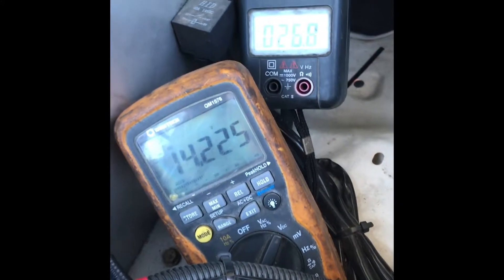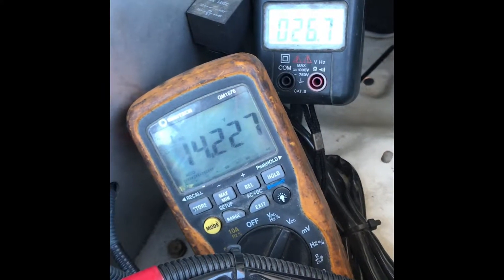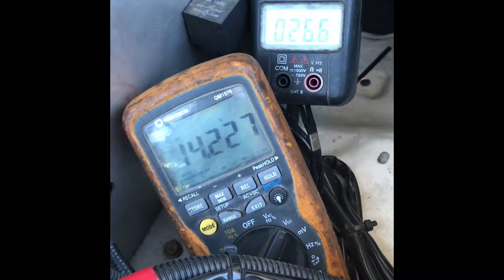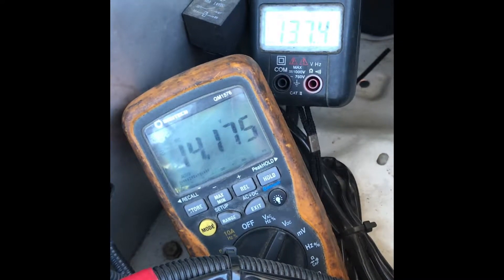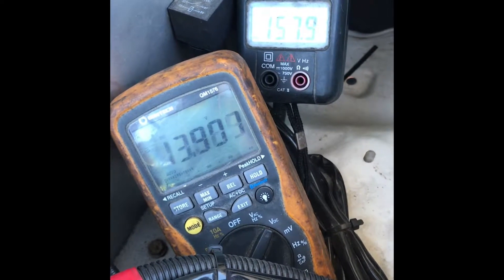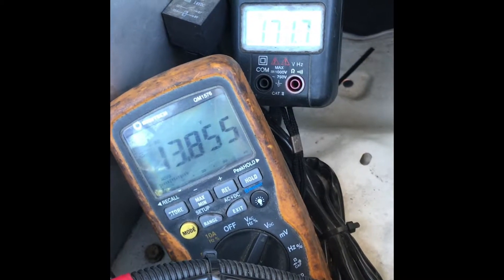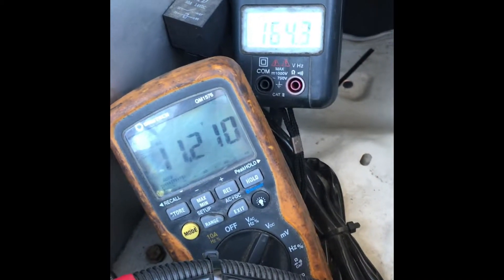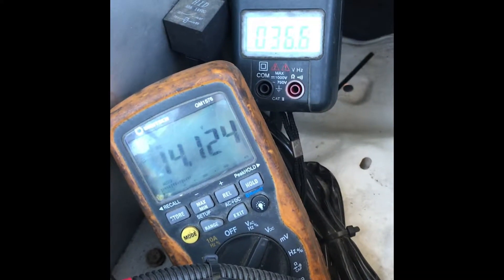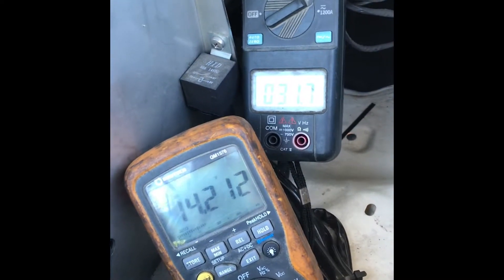It's going to be a little bit noisy because we've got the engine at 2000 RPM now, and I'm going to bring the load on. And there you can see 155, still at 13.8 volts. Now we can get that up to around 170 but you can see the voltage starts to drop away. So we'll produce 150 amps at the correct voltage.